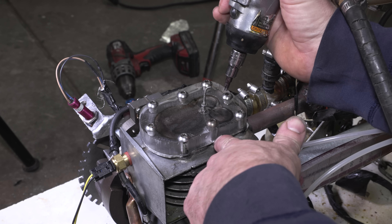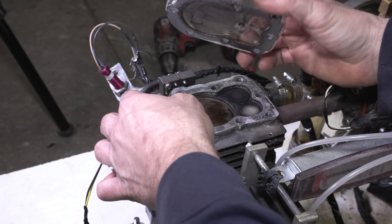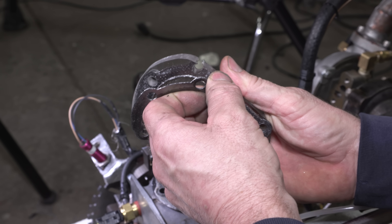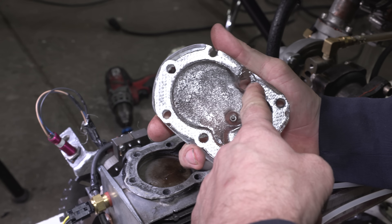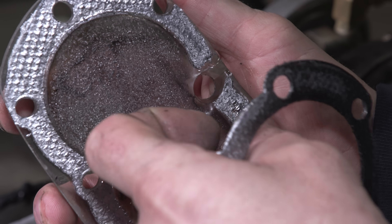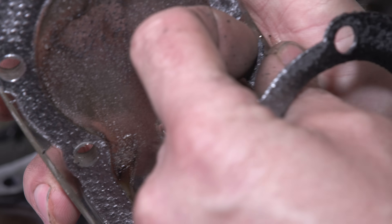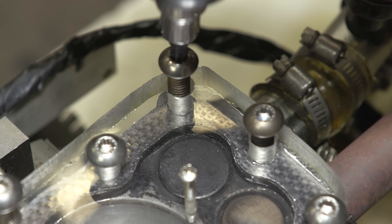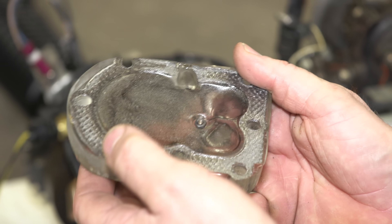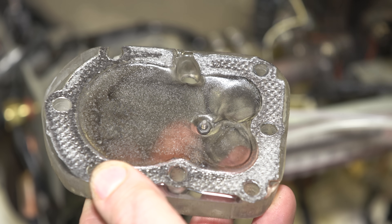I think we blew a head gasket. I have some heavier duty head gaskets - but wait, it wasn't the head gasket. It actually burned a hole right in the head, right through the bolt hole. Look at that - it looks like a piece of melted ice. So I'm going to bolt on this newer style head and see if it lasts longer. It wasn't even the head gasket that went, it was the head itself. It even seems like the engine was using this head for fuel at some point. I'm thinking this might have something to do with the temperature of the block.